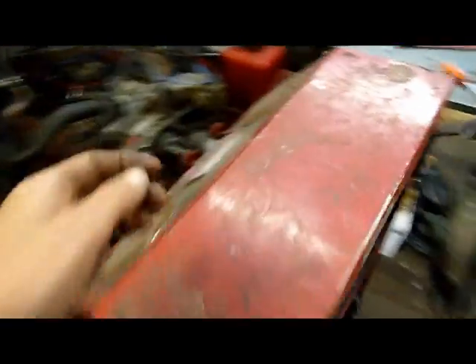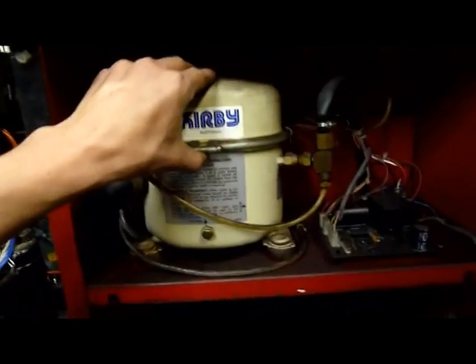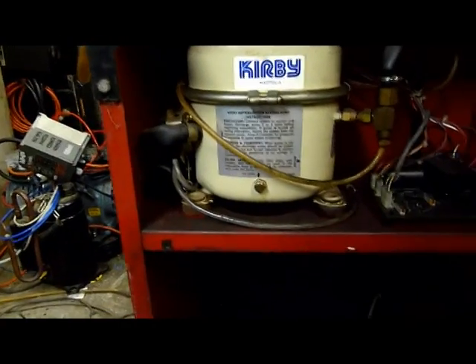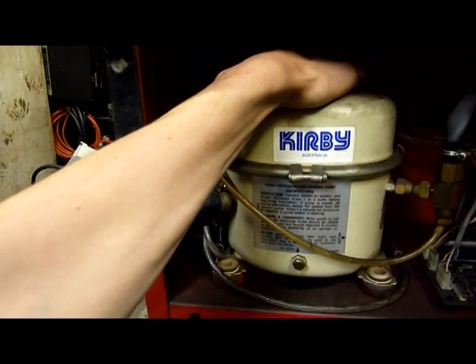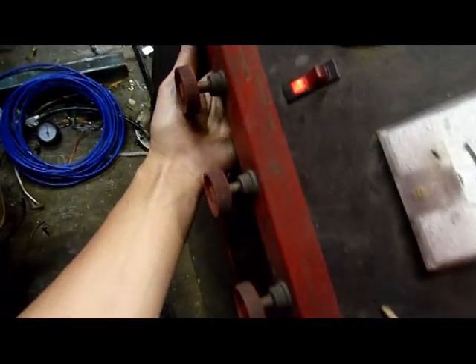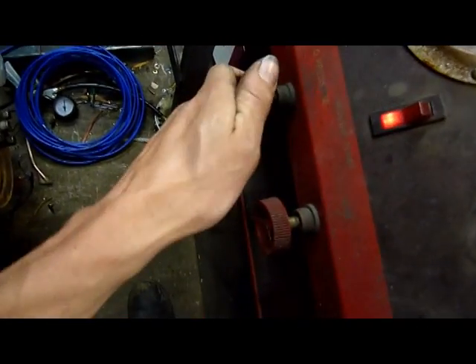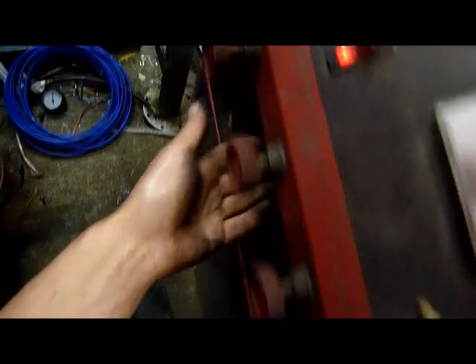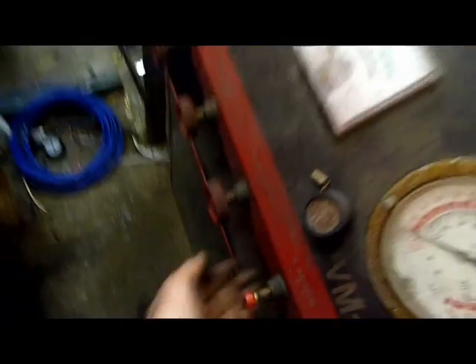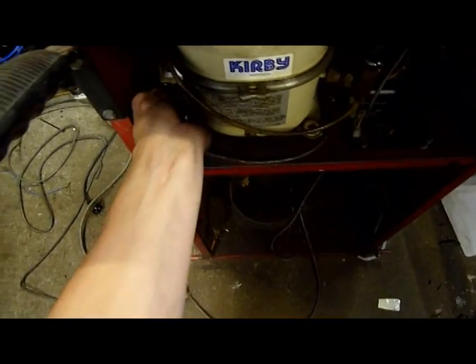Let's see what it does. Well, it is grounded so it's safe to touch. Most of that noise is just crap rattling around in there. The vacuum side is sticky — not really doing anything. Nothing — I'm not getting vacuum, but that intake line is split and dead so I wouldn't expect to get vacuum out of that.